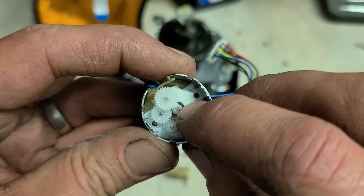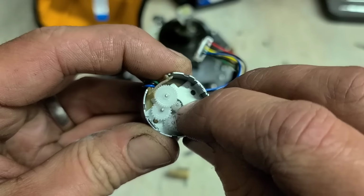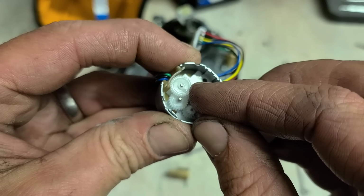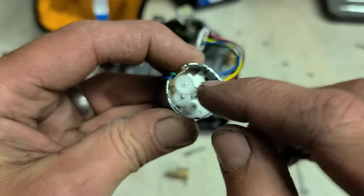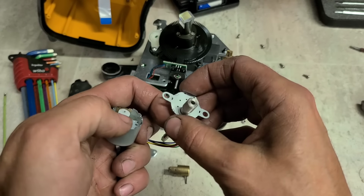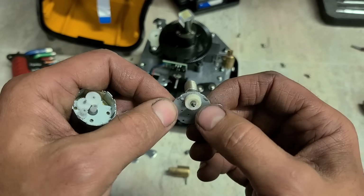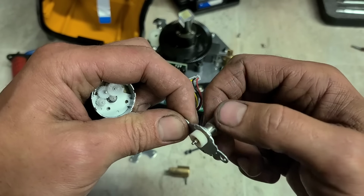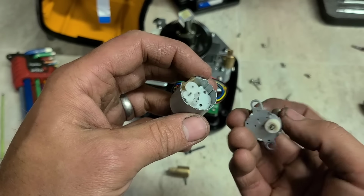So as this motor in the centre actually turns, it's moving this here gear train. So this will be running high speed. It needs to be reducing the speed and increasing the torque enough to actually move this thread on top very easily, but nice and slowly. And that is turning, no problem. So it's actually the gears just mismatched.